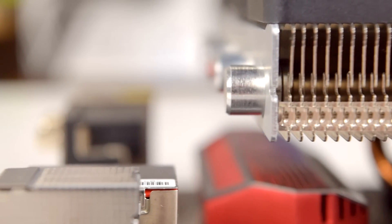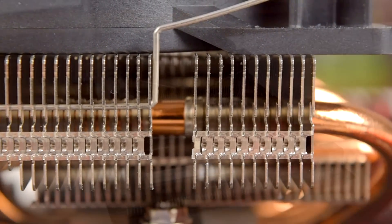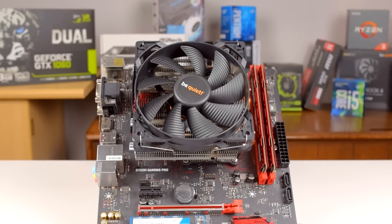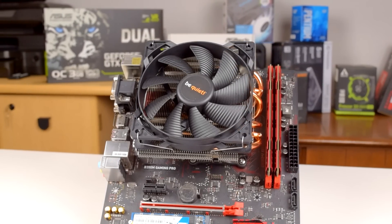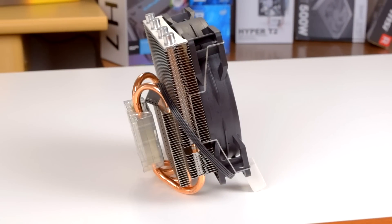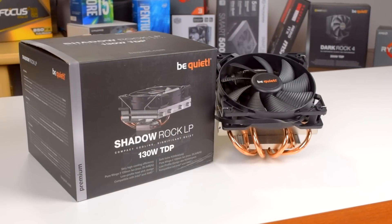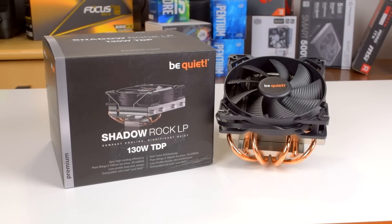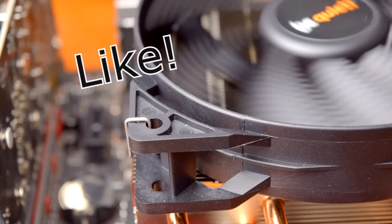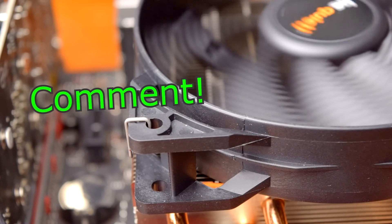To answer the question — are low profile coolers worth it? As long as you're getting it for the right purpose, this one is. If you have a decently sized micro ATX case or a bulky ATX mid-tower, there's really no performance or practical reason to get a low profile cooler instead of a tower cooler. You'd get one because you're doing a mini-ITX build or trying to cram a decently specced PC into a slim case. For those scenarios, your options are sticking with the stock cooler — good luck if it's an Intel build — or getting a proper low profile cooler. In that case, the Shadowrock LP is a really good choice. Click the link in the description to pick one up. Hit subscribe and click the bell icon to get notified of new videos. If you liked this video hit the like button, and if you have any questions on the Shadowrock LP, leave them in the comments below. Thanks for watching, I hope I helped, and I'll see you in the next video.